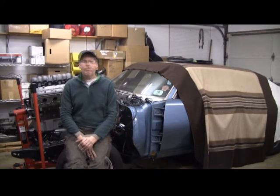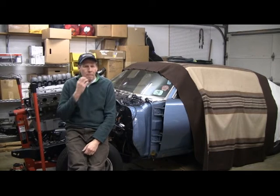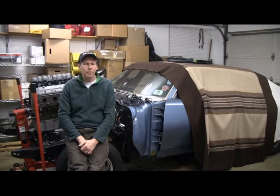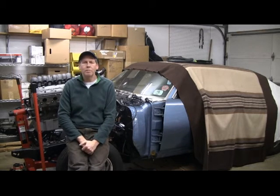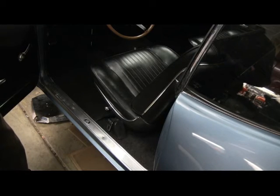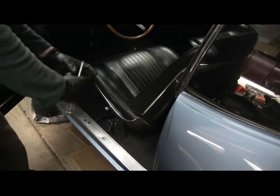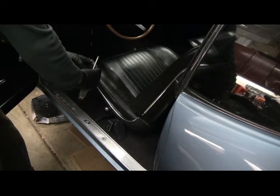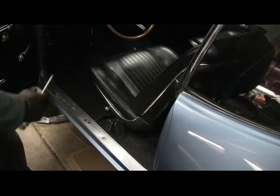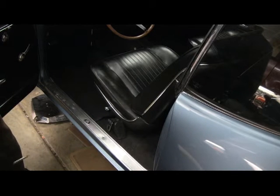So believe it or not, that's what we're going to do. I've looked at a few websites on how to do this with the limited space and equipment that I have. I think I can do it. My biggest fear is that when I take these things off, there's not a lot left to bolt new ones onto. That would be the worst case scenario. The cage nut is like a nut in a housing that's allowed to move around a little bit so you can get everything lined up on the frame. If it starts spinning when you try to take it off from the bottom, you're basically screwed. What's suggested is to drill a hole above it so you can get a lubricant like liquid wrench in there, maybe some heat to try to loosen those things up.